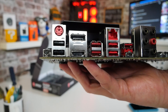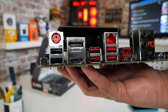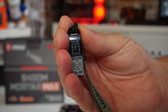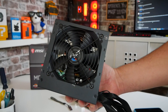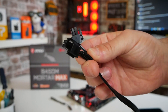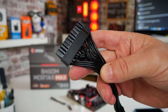So what you're going to need for this is obviously your motherboard itself, you'll need something to put it on — a table or maybe use the box that the motherboard came in. You'll need a USB stick which will be formatted to FAT32 and needs to be 32 gigabytes or less. You will also need a power supply with two connectors: the EPS connector for the top left corner and the 24-pin main power connector for the side of the motherboard.